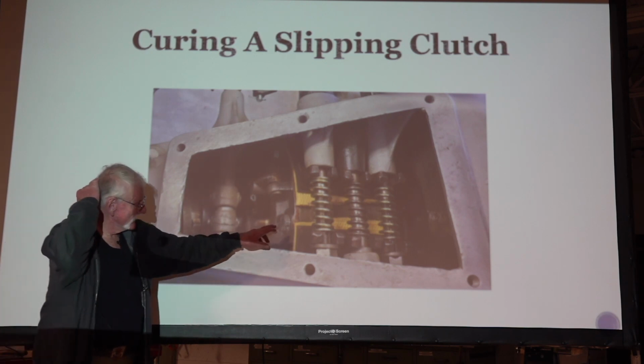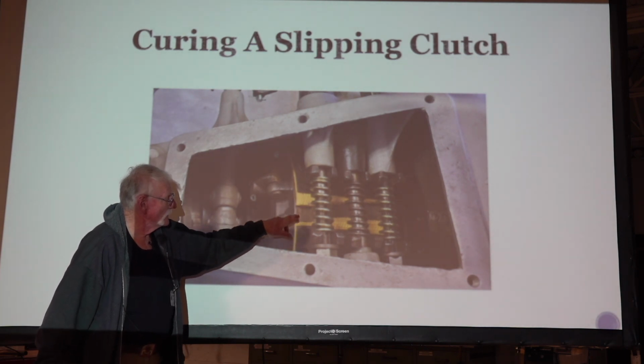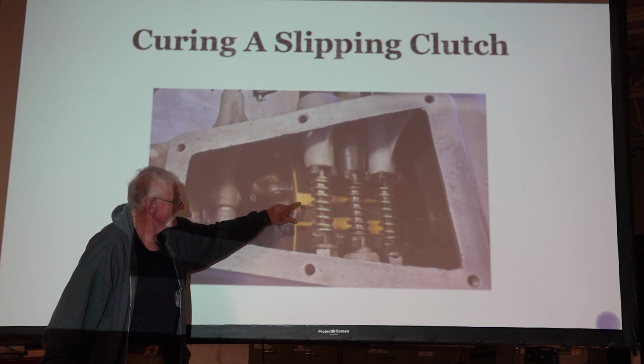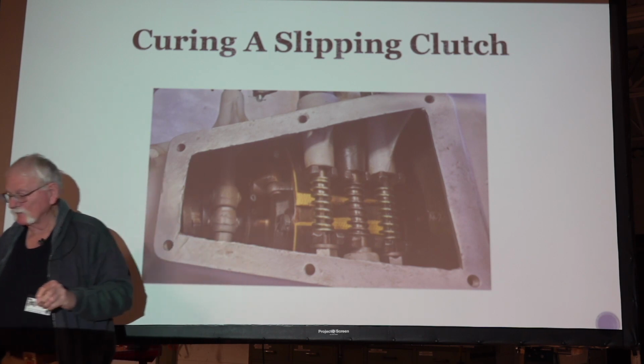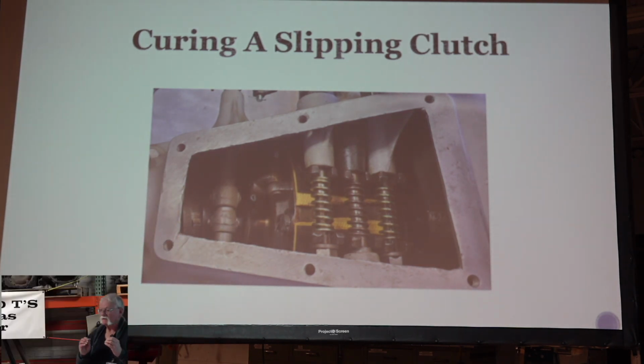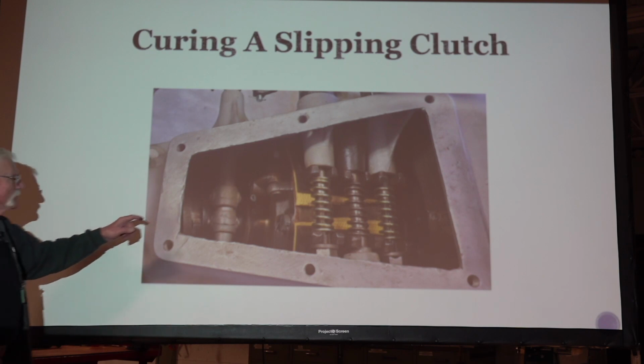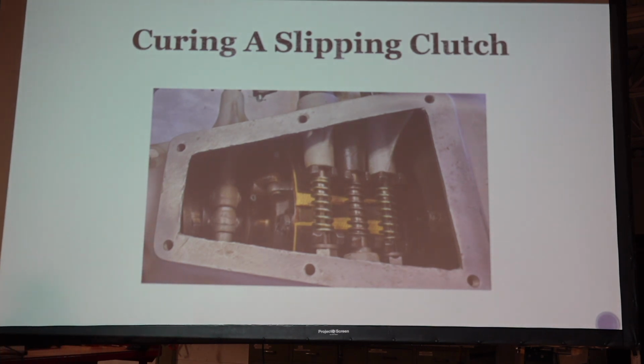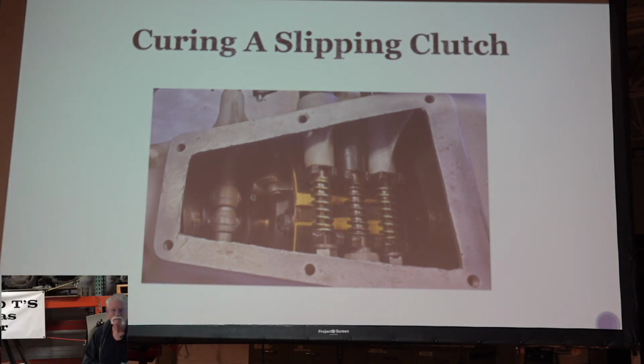Here's another thing that is very common on a Model T. When you put brake bands on your car, this is right, this is wrong. You put both of them about this distance, just let it overhang about an eighth of an inch, the idea being so that the brake band doesn't grab into the drum. And then you rivet it up here, and you rivet it over here, and then you push that lining down into the brake shoe, or the bands, and it'll all compress and be just right.